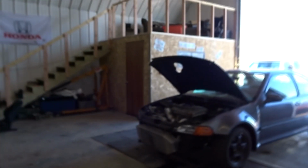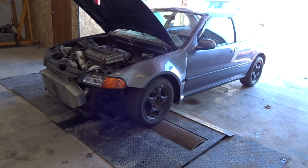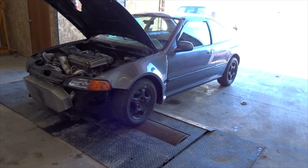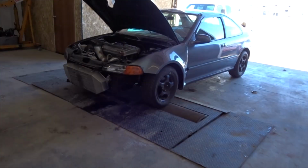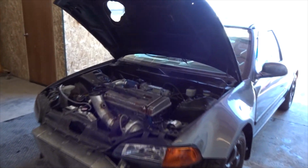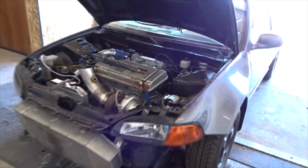Alright guys, so it's been almost a week now since I filmed. We've just been super busy out at the shop, and we had some complications with the purple car. As you guys can see, I have it loaded back onto the dyno now, and I'm going to try some things to get it to work a little bit better. I do believe we are having some injector issues. I don't have the right data for these Snake Eater 2200s, and just to alleviate some issues, I'm going to throw a set of Hunter Tuned Flex style injectors into here.